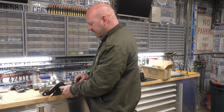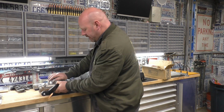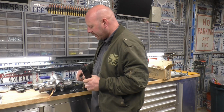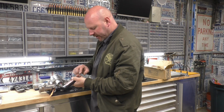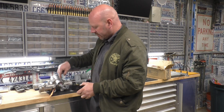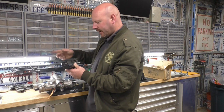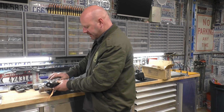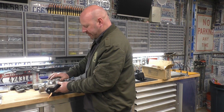But in my research, I did not find that the keys are basically just missing a spline in the arm. On those 99 up Grand Cherokees, they're not symmetrical like on the XJ. Basically, they're going straight across from each other and straight forward and back from each other. On that 99 Grand Cherokee, it fits, but it puts it like there in center, which isn't going to work. So it's either there or it's down there. So that doesn't really work.